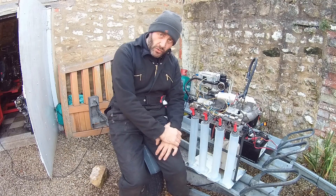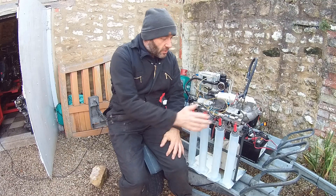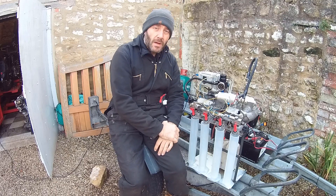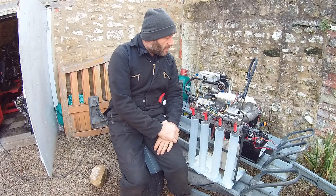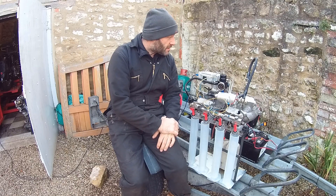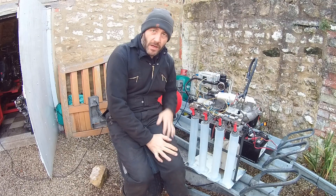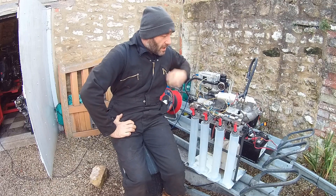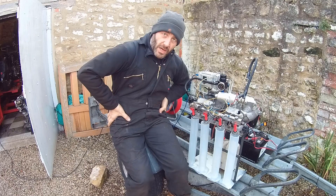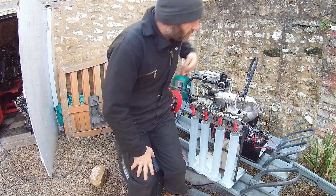You can't use relays because relays won't react in milliseconds — you need about 10 milliseconds or more for a relay. So to control the four injectors I'm using an Allen Bradley Micrologix PLC. The inputs were broken on this one, but we're not using those. On the outputs we can program it to run on those cycles. We're using a transistorized output card, and because we're using coils on all the injector connectors, I've put a flyback diode in to protect the transistors in the output card.